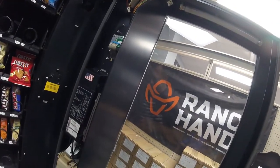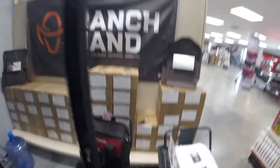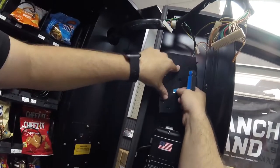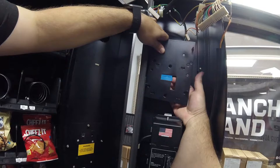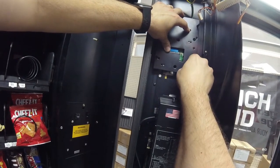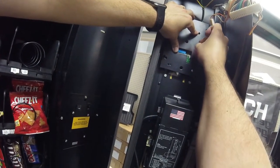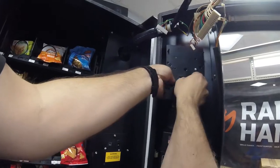Our display is installed and everything is in place. Now we need to reinstall the black mounting piece, and the new VMC will attach to that. One thing I struggled with — I was trying to get the display cable through a hole in the mounting piece, but that's not how it works. The keyboard button connection comes down below the mounting kit, not through it. Don't make my mistake — I wasted a good minute or two on that. Now let's get the new board mounted up and get this mount connected.